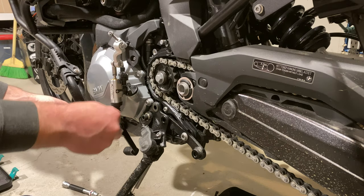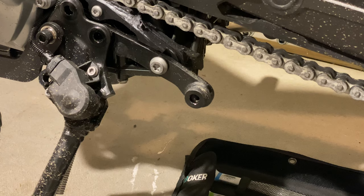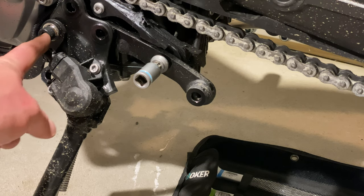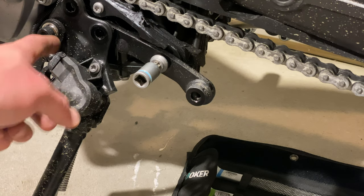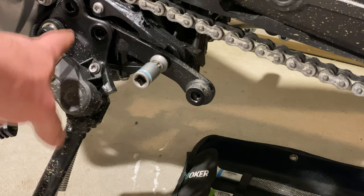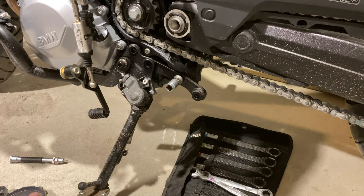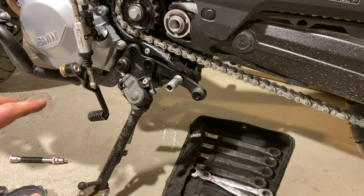In the same light, we're putting this back in its hole here. We're putting this washer back on the back of the shifter. The next instructions indicate that this bolt needs to come out — this bolt is also, by the way, a T-50. So right now the kickstand is only supported by this little Allen right here, which is only there because of the GV crash bar, so you'll probably have a Torx in your case. Instead of three bolts holding this kickstand mount in place, you only have one. So I think it's best to lean the bike against the wall or have a friend hold it, because with this kickstand only having one bolt holding it in, you're putting a lot of pressure on that one bolt and it could bend.